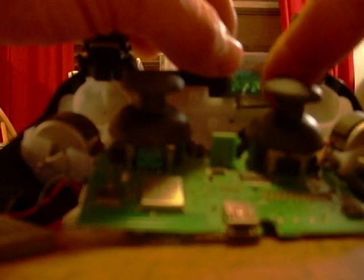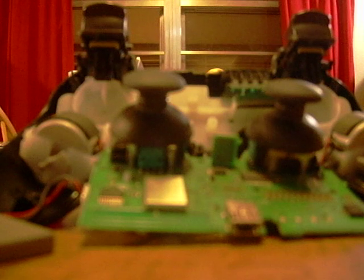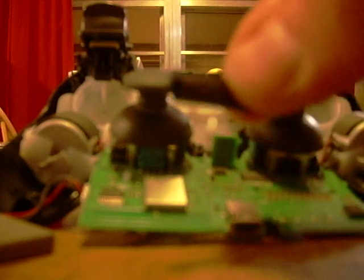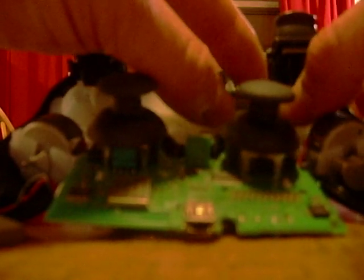And the easy fix for it is to put a couple of strips of tape back there just to thicken it up. And I just use black electrical tape. You just cut a couple of strips, or even just one strip, and roll it up like I've done here. It's probably like 1.5 inches of tape, and then it's just rolled up. If you'll take that and set that back there, it'll give it enough thickness that it will force the ribbon forward. And when it does that, it gives you just enough contact that it won't wiggle out.